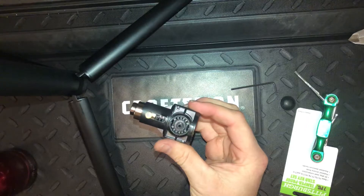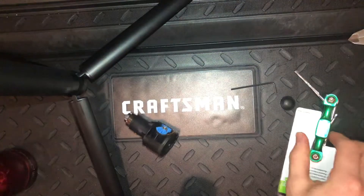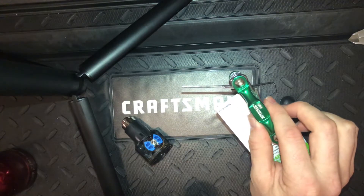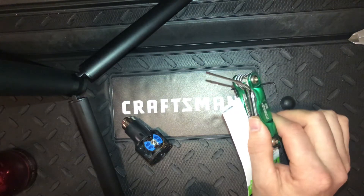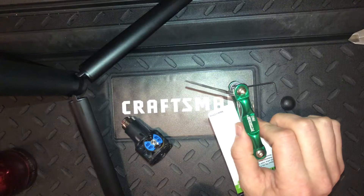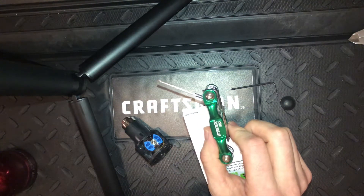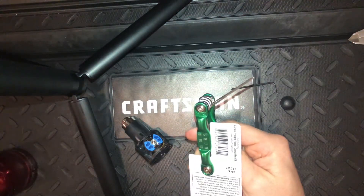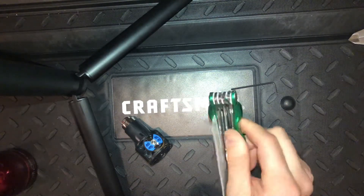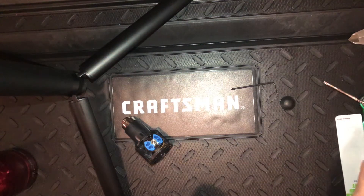Down here is the screw that presses against the inside wall and holds it in place. Now we can clean it and put it back together. Basically, you need a T8 Torx head screwdriver. If you can find one that's really skinny, lucky you — I looked everywhere and couldn't, so I had to modify my own. A Dremel or grinding wheel makes it easy. That's it — thanks for watching.